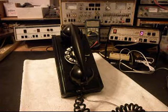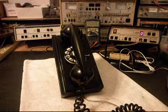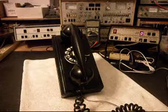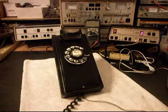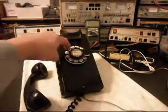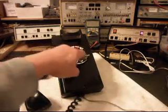We're going to go ahead and ring the telephone. Now this bell will pull some ring current out of the line. We're going to let it go a few more times since that was the issue. Give you some dial tone. Now we want to walk through our numbers — if you watch the analyzer, you'll watch the numbers roll by. The rotary is returning properly and smoothly.